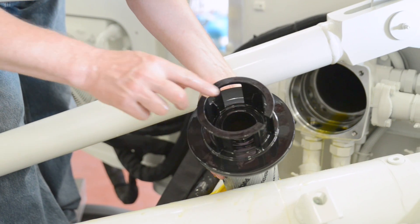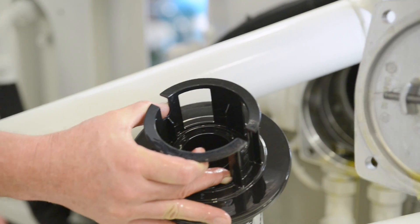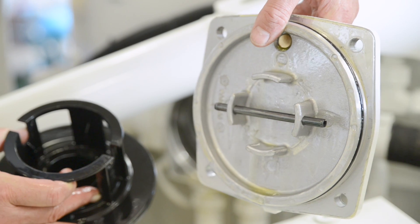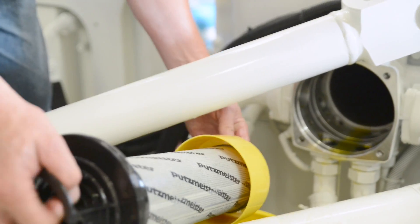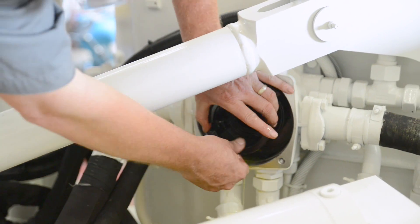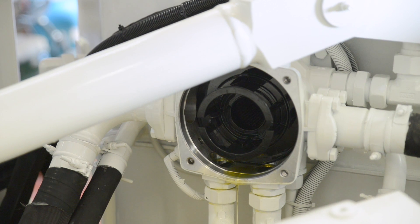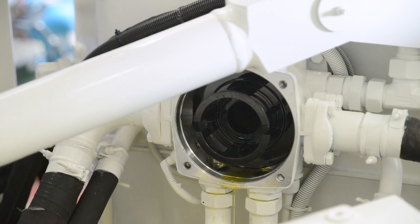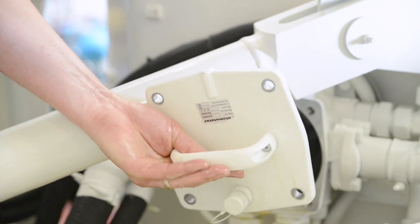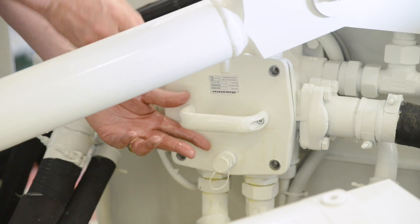You want to take a clean rag and wipe everything down inside the filter housing. It is important to note the notch in the top of the filter — this notch must line up with the notch inside the cap, so we must make sure they align when we put it back together. Install the clean new filter, make sure the notch is horizontal, and just give it a light tap in.